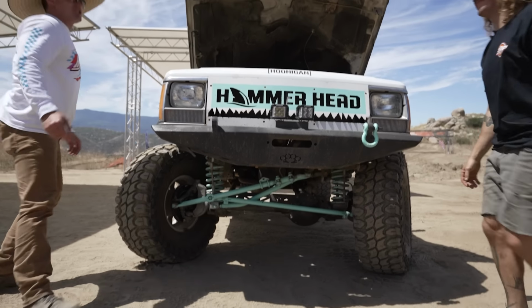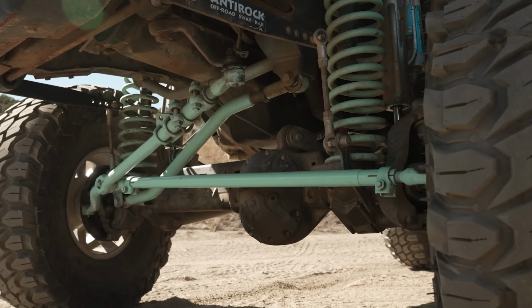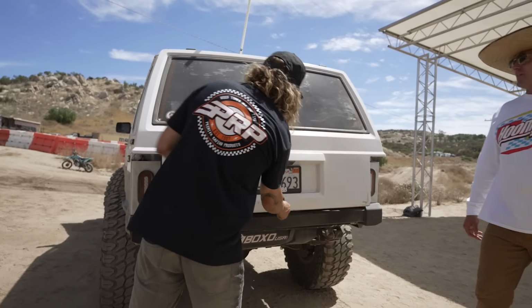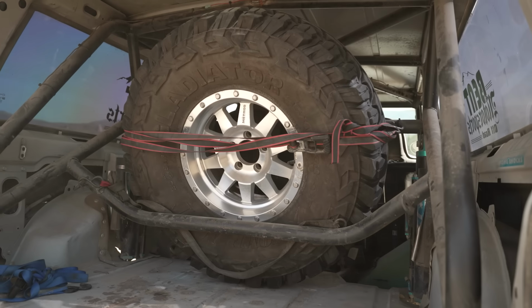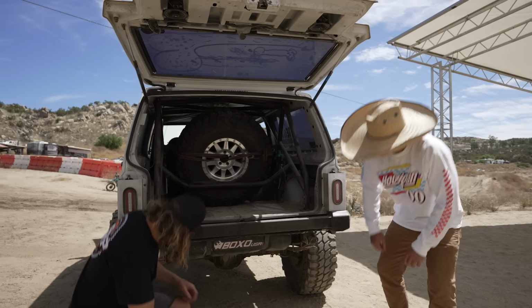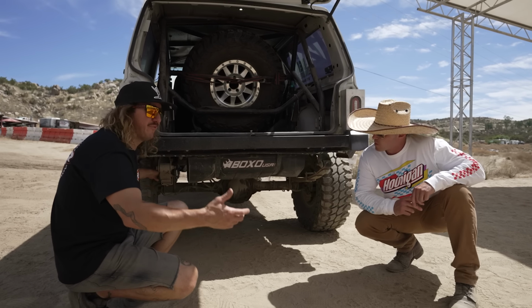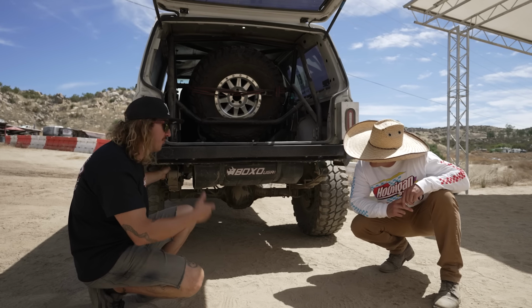No doubt. Because that's where all the action happens, right? There is some junk in the trunk. Show me what that booty do. Bam! Full 1¾-inch roll cage in this, all DOM. We got King triple bypasses in the rear. These are 12, so the rear cycles 12 inches of travel. And if you look underneath of this bad boy, we got a junkyard 8.8, paired up with some leaf springs that were like $57 a piece from 4-Wheel Parts, and a different shackle to help the swing of it.